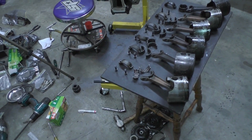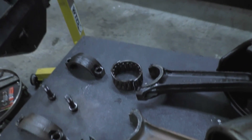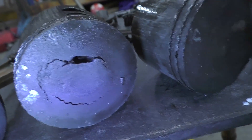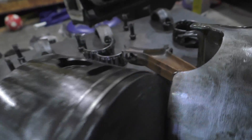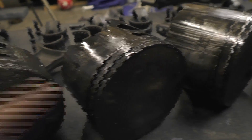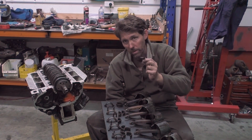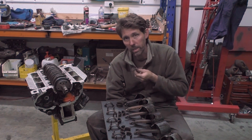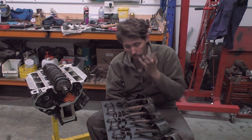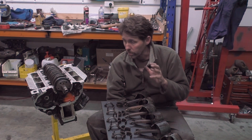This is what we're left with: six end caps, six sets of big end bearings — none of which look particularly bad to be honest. None of them totally disintegrated. And now six pistons — this is our melted one. Some are quite good, some are heavily scored. What pleases me about the big end bearings not having failed is that it means there doesn't appear to be any damage to the crankshaft — that's great, saves money and work. We're getting all new forged pistons anyway, which is a little better than original, and we're re-boring the cylinders.